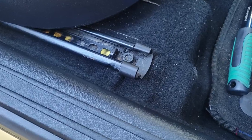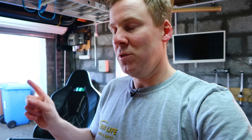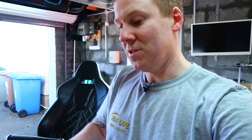The process of taking the seat out of the car is pretty straightforward — it's just four bolts with a multi-spline tool to pull them out, then disconnect two multi-plugs for the airbags and the sensors inside the seats. You might notice in the pictures that there's a lot of foam debris on the carpet. This seems to be a common issue with these seats — the side bolsters wear and the powdery foam just lands on the carpet below the seat. If you look under your seat you can see if part of the bolster foam is on the carpet, and this is where it's coming from.